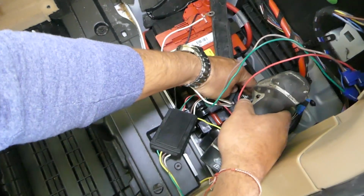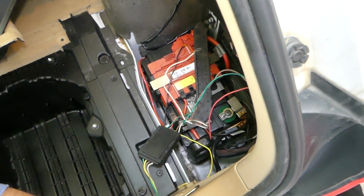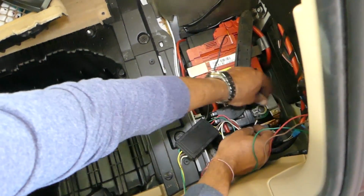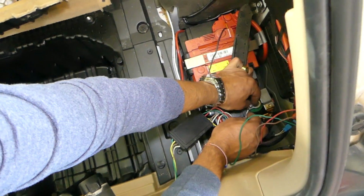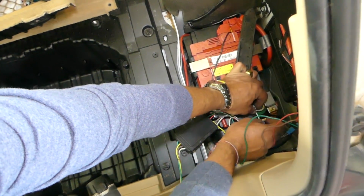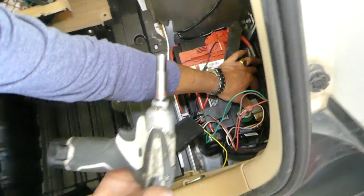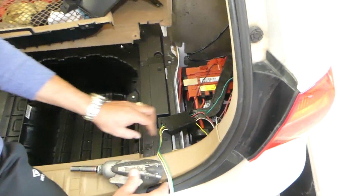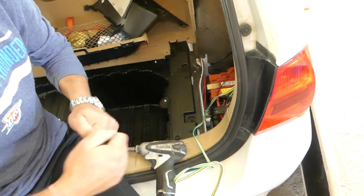And now we're going to connect the negative, which in our case is white. You always have to check the colors and to which one it corresponds, because often it will be different. So do not take the colors for granted. Always check it, even if it's the same year, same model car, things might differ. Even if you bought the same connector type, trailer wire kit, still it can differ, so always double check that. And now we're going to put everything up and we're going to put it to the test and see if it works.